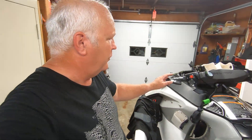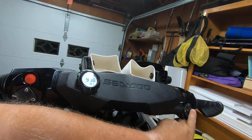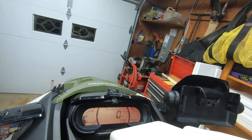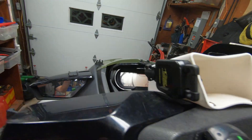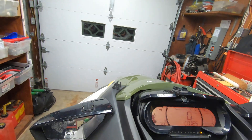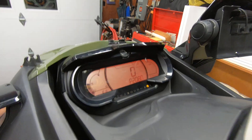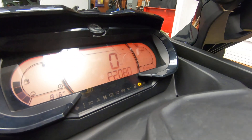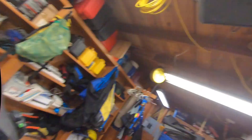The way you access the fault codes is you press the right arrow button on the 2019 FishPro, then settings, hit OK, and the codes come up. If you continue to press OK, the code shown is P2080. Looking that up in the book or online, P2080 is the exhaust gas temperature sensor.